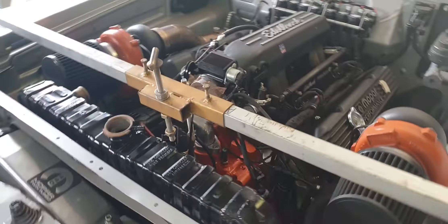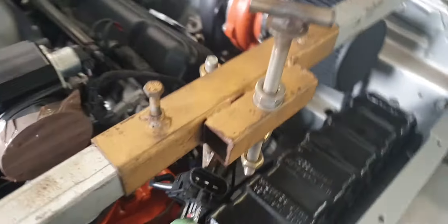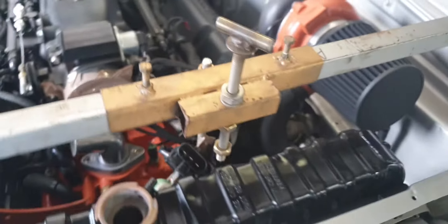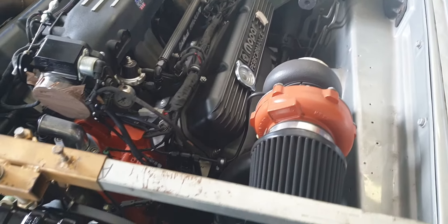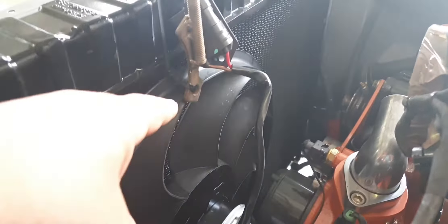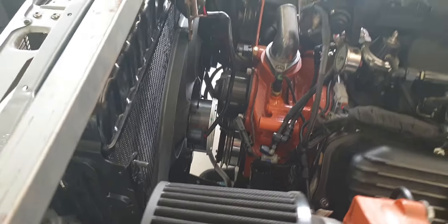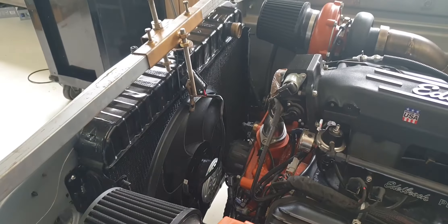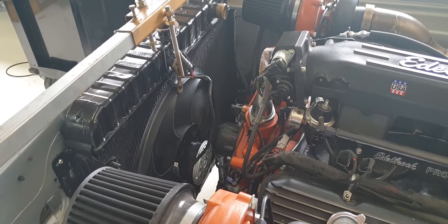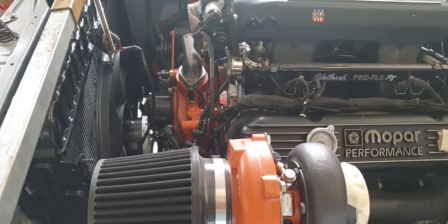Those who are asking — this is my little turbo mounting jig. It's just a little homemade thing, out of a bit of box with airline hose on the side so I don't scratch things. It's fully adjustable, and you can see I've got a bunch of different rig-type ideas that I can bolt or screw turbos to — it's what I use to actually mount these guys. I'm going to hang them until I set the position. Down on the bottom I've got a different bolt-on option, so I'm just using that to hang my fan, locate it, and sit it exactly where I want. Then I'll take my measurements and make a shroud to make it all work.